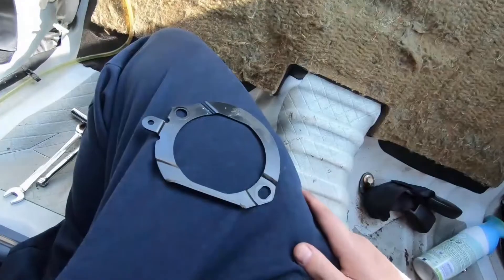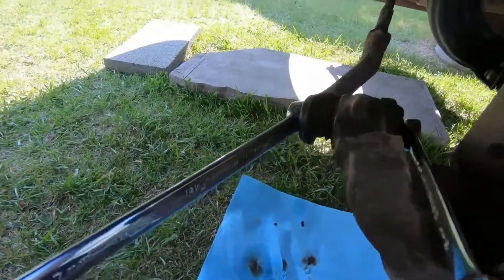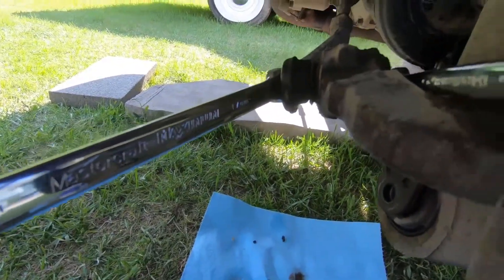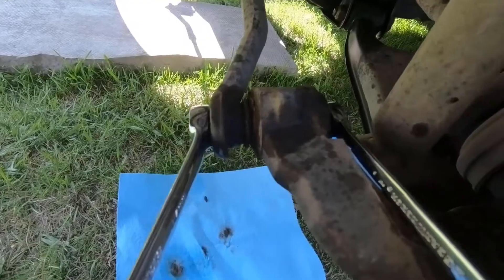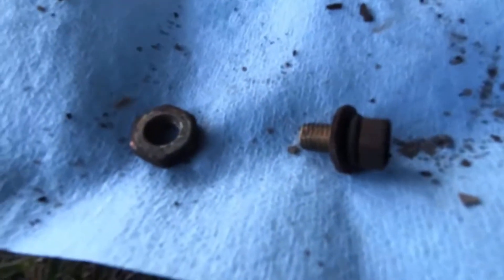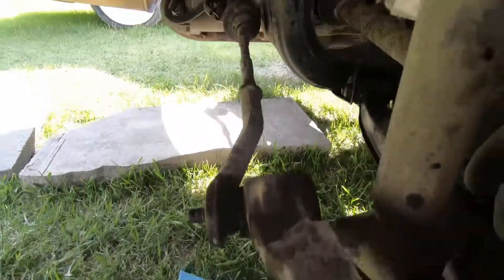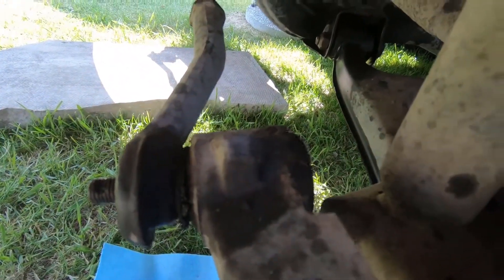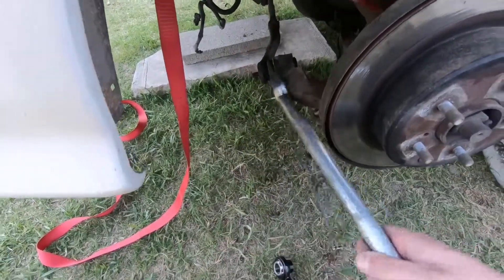There's the top — you'll want to reuse that. For the backs, it's a 17mm and 12mm for the rear arm where the hicas assembly connects. There it is, removed — 12mm on one side, 17mm on the other. Now this bushing is a nightmare to pull off; I'm not going to lie, I tried for three days messing around with it.